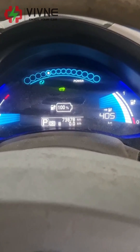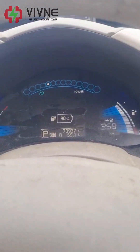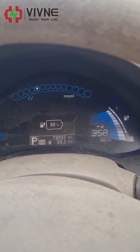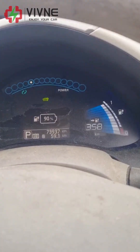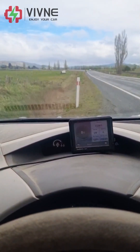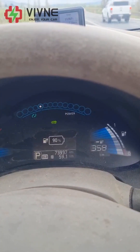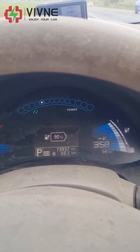We're going to take it for a test run. I just done 10% on the dashboard and I've done 59 kilometers, and I've still got 358 kilometers left. The Leaf Spy says 87%. It performs quite well. Temperature is 30 degrees in the batteries. If you add the 59 to the 350, you get over 400 kilometers.